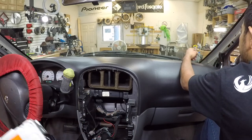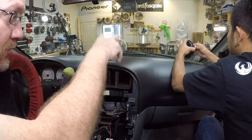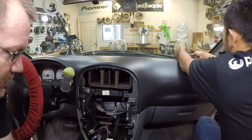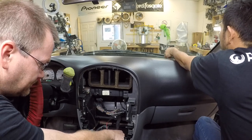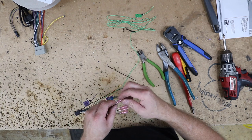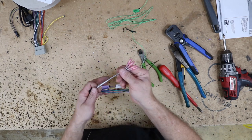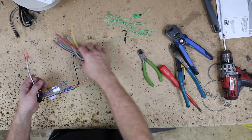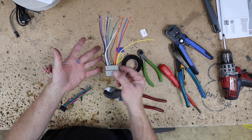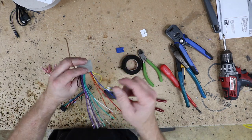Now we need to make the harness. We're running new speaker wires for these two dash speakers. These two are going to be front on the radio, and then the driver's door speakers are going to be rear on the radio. We're not going to connect the very rear speakers as mentioned. So we're going to add some quick disconnects to the front outputs of the radio so we can plug in the wires that Fernando's running. We're doing that first so I don't get confused when wiring it up. We want to take this into the car and check what wires are there — specifically the power antenna. There's nothing for the brown one so we're going to remove that, but I want to check the power antenna.